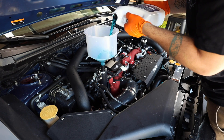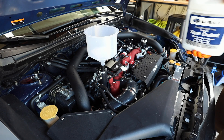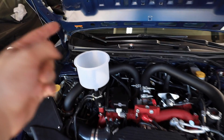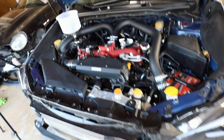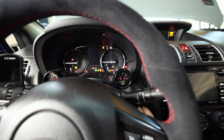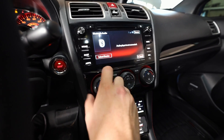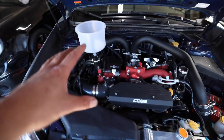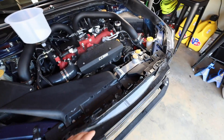This funnel took me a minute to figure out, but we got it on there. If you don't know how to burp a car, it's extremely easy. You're going to need your key, open the door, put it in accessory mode, turn the heat on max, turn the defrost all the way up, then start the car and monitor coolant temps to make sure you get all the air out of the coolant system.